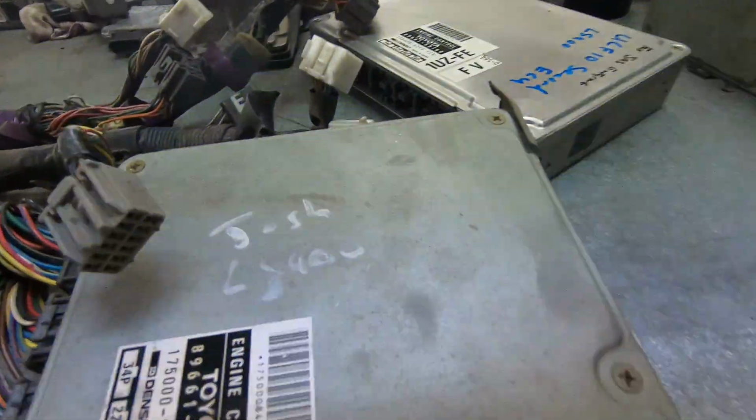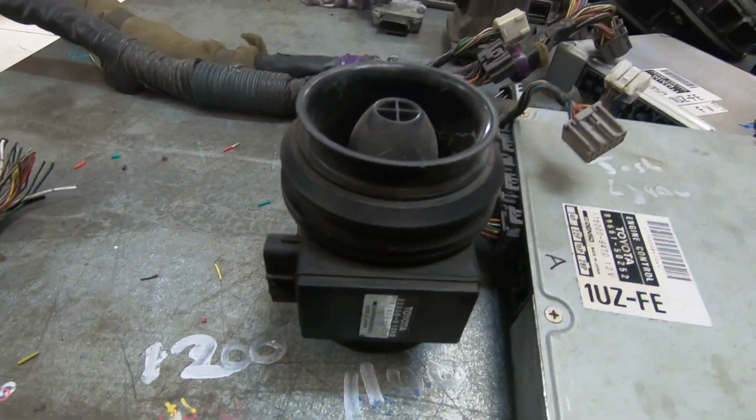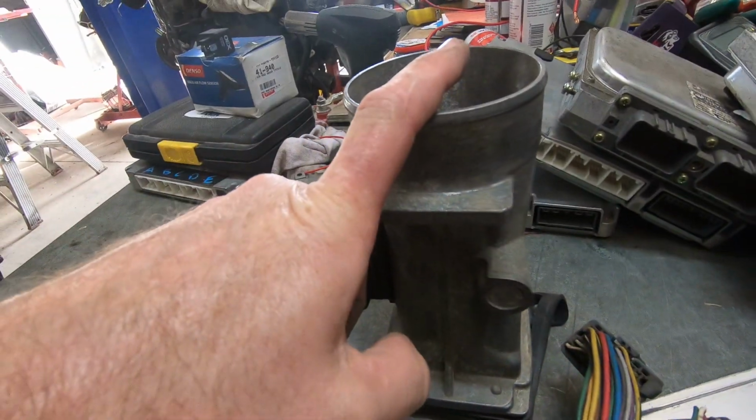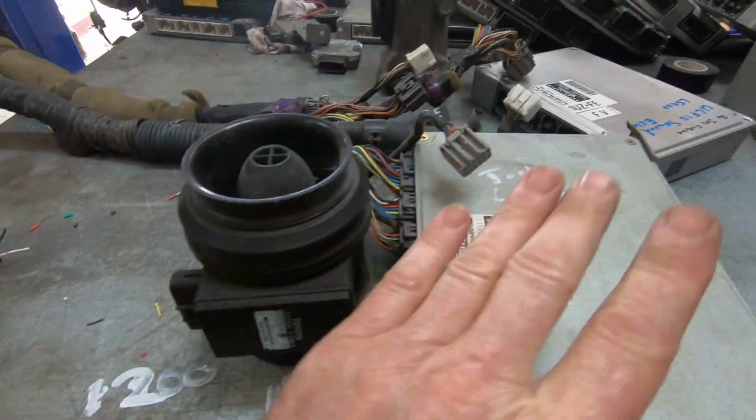Hot wire airflow meter. This one gets a 5-volt supply from the ECU. This gets a 12-volt supply externally. And that is why we can't interchange and plug into these different looms the UCF10 into the UCF20 or the 20 into the 10.